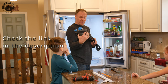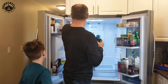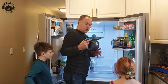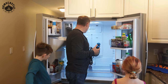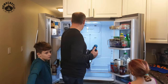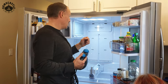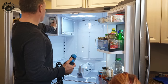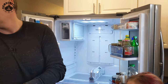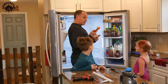If you have a frozen condition, this little steamer is going to save you hundreds of dollars. It's intended for cleaning, but it's really useful if you need to defrost this ice compartment. If you see ice encroaching on the vents, fill up your steamer, unplug the refrigerator, and direct steam into those ports — that'll help loosen the ice and hopefully prevent cracking the panel. Same thing with the ice bin: direct steam up into the outlet to melt frozen ice. It's also helpful for defrosting your car.